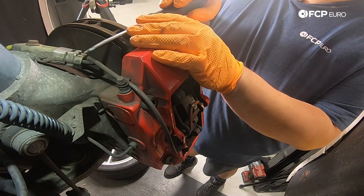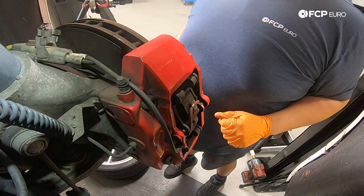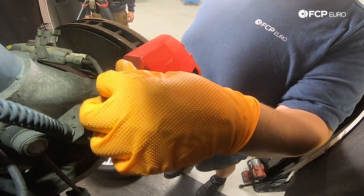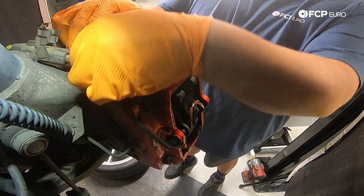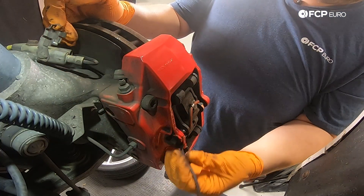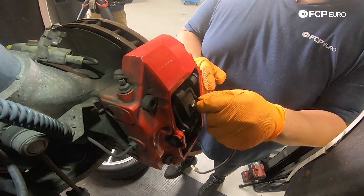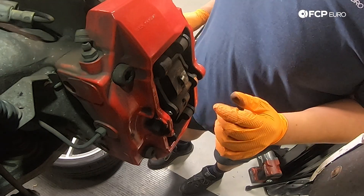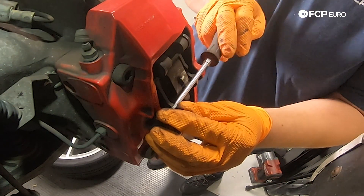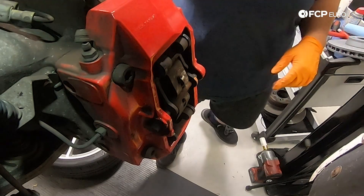Now to get started we're going to begin by undoing our brake pad wear sensor. I like to take a small flathead and just pry up the metal flap. With that up, we can go ahead and undo the protective cap on the brake bleeder. Once we've done that, we can disconnect our sensor from the car — it just pulls out from the pads. Next, before we forget, we want to remove the cotter pin on the caliper. This cotter pin holds our bar in place that keeps our pads from coming out. The hardware kit comes with a new one so don't worry about losing it.